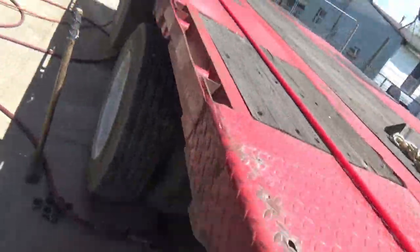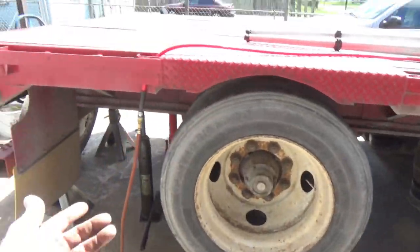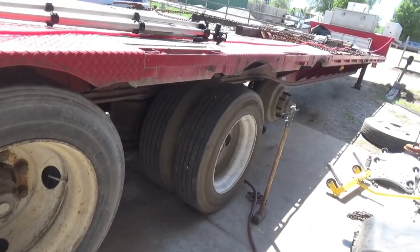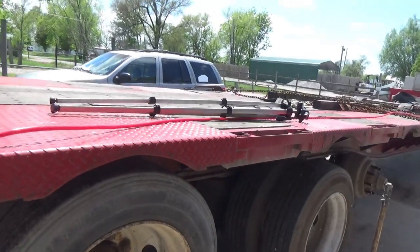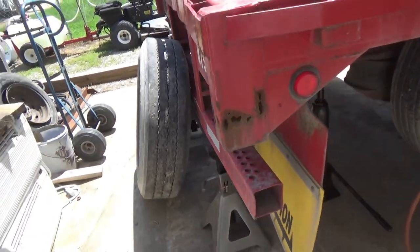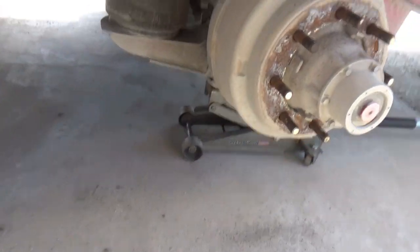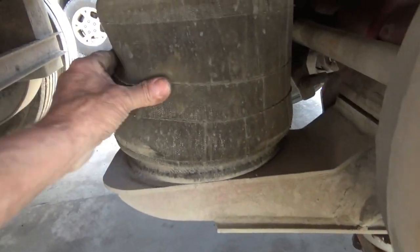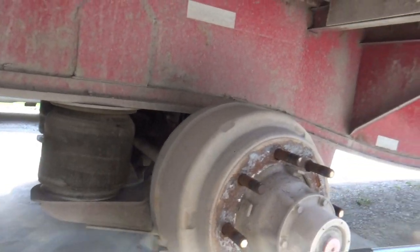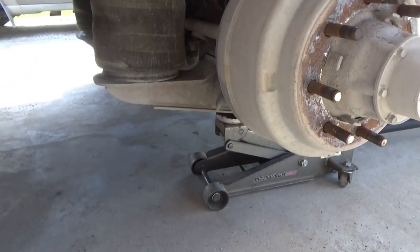It's plugged into the shop air and the airbags are not going to fill up because I've got the back end of the trailer jacked up high enough that the wheels are below the level the leveling valve would have it fill with air. There are jack stands for the safety-conscious — it doesn't really need it because all the wheels are on. If it came down, the axle went up and the leveling valve allowed air in, that might be too much pressure for the floor jack.